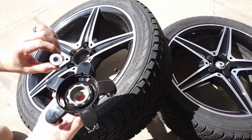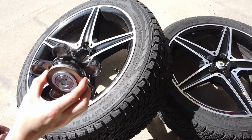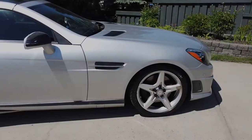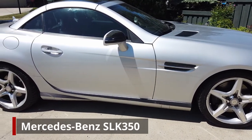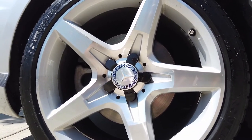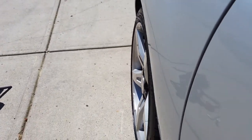These are made with solid 6082 aluminum — the kind used in high-stress applications like bridges and cranes. It's thick enough to make it difficult for someone to easily chisel or angle grind. Not to mention there are 20 arms in total that a thief would need to cut through to be able to access all the bolts. So not only will it take a lot of time, but they are going to create a lot of noise and attention. Plus, the wheels could get damaged during that process.